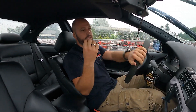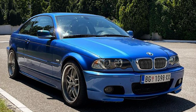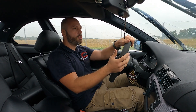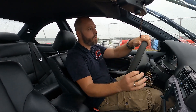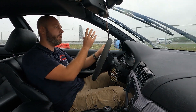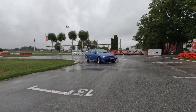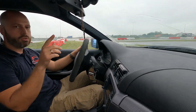The limited slip differential — that is the key point. This car does not have a limited slip diff; it doesn't have it from the factory as the M3 had. So today we are shooting this video to show you guys how to upgrade the drivetrain, how to install an LSD unit from E36 or E30 — the previous factory LSD units — into such a car, to transform it to go like an E46 M3. So stay tuned.